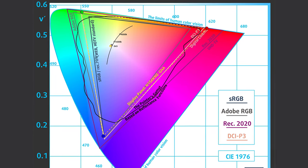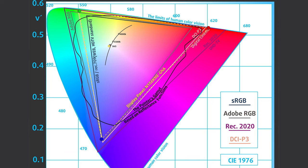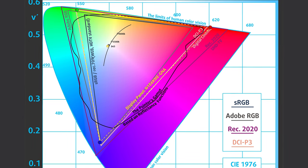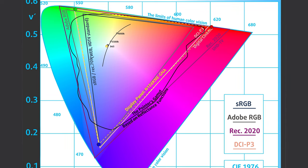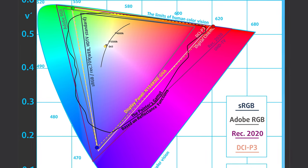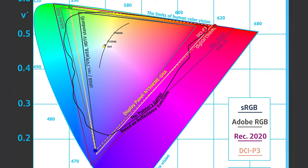The yellow dotted line shows ASUS ROG Zephyrus G15's color gamut coverage. Its display covers 100% of the sRGB, ITU-R BT.709, web, HDTV standard, in CIE1976, and almost matching the DCI-P3 color gamut, resulting in a vibrant and punchy image. Our design and gaming profile delivers optimal color temperature, 6500 Kelvin, at 140 candelas per square meter luminance and sRGB gamma mode.